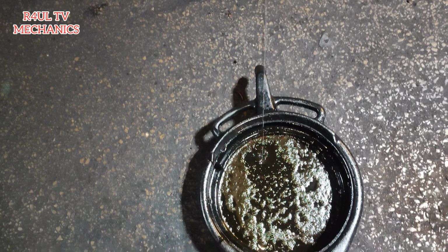Right, okay, so let that drain. As you can see that it's draining out. We'll just leave that to the side, let it drain out. We're going to tackle the oil filter now. The main objective is to take the oil filter off, okay? If you've got the oil filter tool, you can do it with that. If you're strong enough to do it with your hands, you do it with your hands if you want. I just get these on it, okay? And I don't care if people are saying they're pipe pliers, they do the job for me, okay? So there we go.